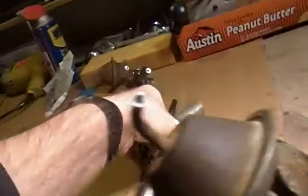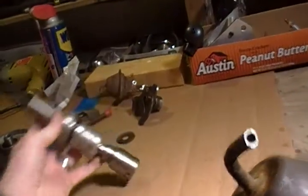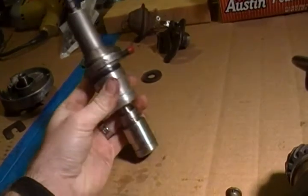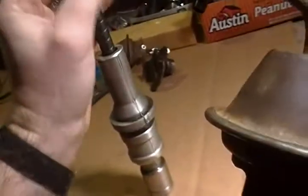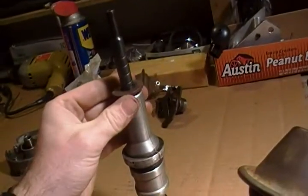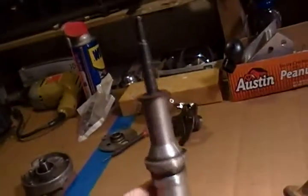So basically what I've got now is the distributor gear with no teeth on it, but it's still got the hex part in it. I'll slide this down over and there is a space that you need to leave there. If you look at the bottom of the distributor, there is a space in between the bottom of the housing and where the actual gear goes, so you want to maintain something close to that. You'll bring this down so far leaving your space — I'll probably just use that body shim there to space it — then get a washer and bring that down the same way Tommy did in the episode, get your spacing right, and just tack weld that to the shaft. That will allow this shaft to turn inside the housing, priming the oil pump. It'll be held there so you can pull the whole thing out as a unit, and it still leaves a little bit of play so you can spray some lubricant down in there.